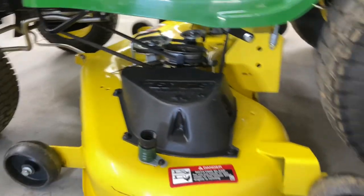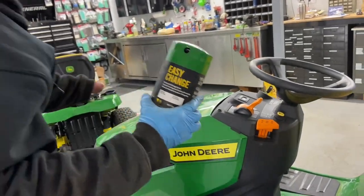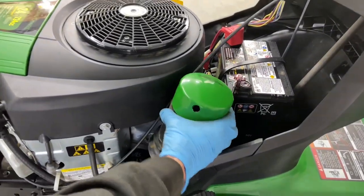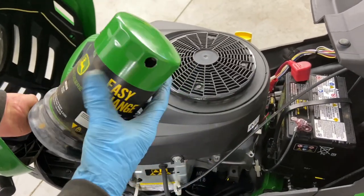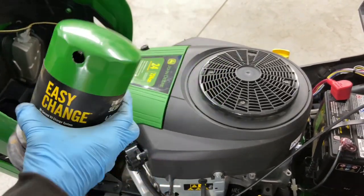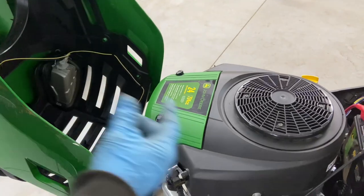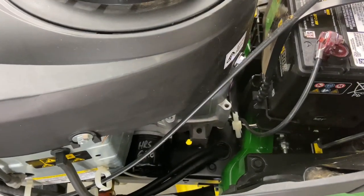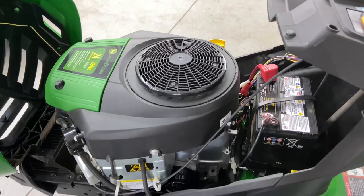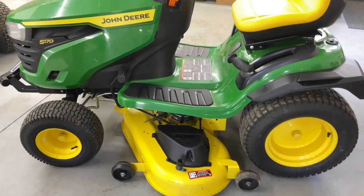Now, what I was saying about the oil filter on this engine — let me show you right here. This is what they call the Easy Change Oil Filter; it came on this S170. This is a twin-cylinder Briggs motor. If you have one of these filters, this is a $50 filter. It only has about three-quarters of a quart of oil in it, and when you change this out you're only changing out this much oil. That engine takes two quarts of oil. So I'm going to put a link in the description below on how to get rid of this and go back to a normal oil filter and drain system — to get rid of this expensive filter and be able to change 100% of your oil. I appreciate everybody watching. If you have any questions or comments, please leave them below. Give it a thumbs up and I'll catch you guys on the next one.